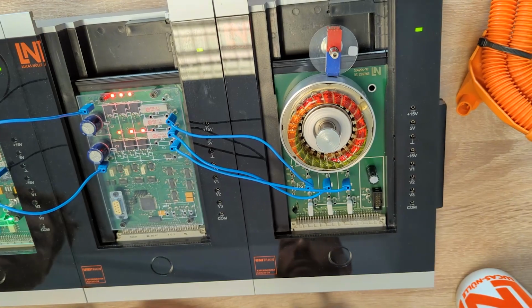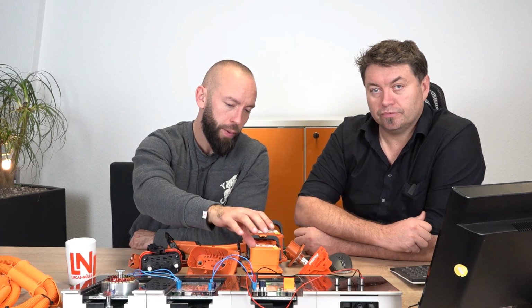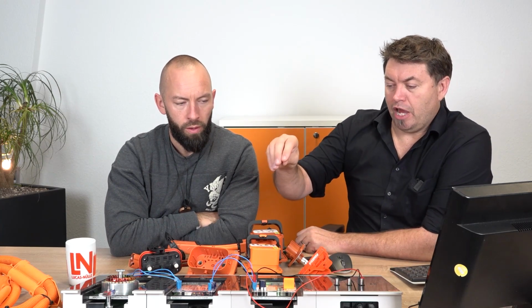Cool. So if I just start the electric motor there, you can see how the electric motor is now taking off. We see the electric motor turning, we see how the inverter is controlled, and we see basically that the high voltage battery is connected to the inverter. Exactly. So all of those connections, now we don't have an interlock on every connection like you do here, but we put it here so that you can at least see what that looks like.